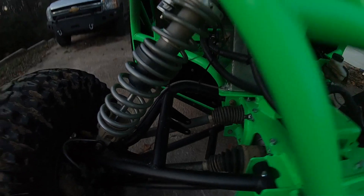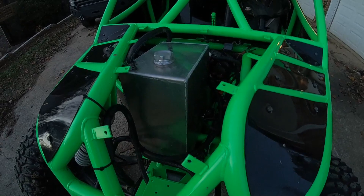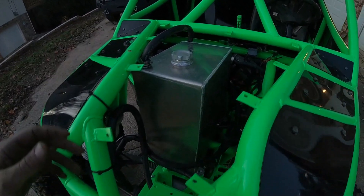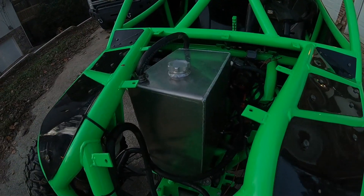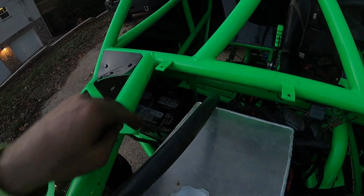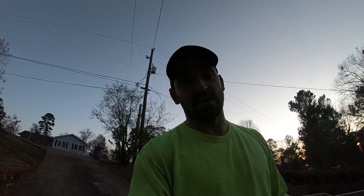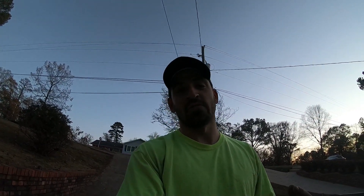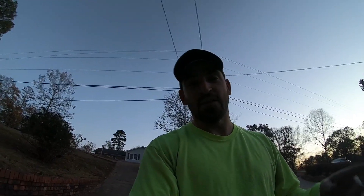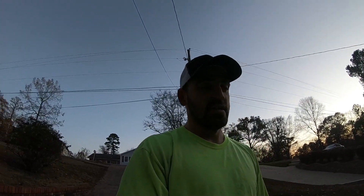Running Kryptonite tie rods. The fuel cell is probably around eight to ten gallons. I didn't have a rollover valve, so what we did is we got a piece of half inch hose and kind of looped it around up and down and side to side, that way to keep it from spilling out. We had to replace the battery Saturday morning — the battery was shot after sitting because I didn't put it on a trickle charger. And this one diff — got rid of that old diff. If you've seen the last video where we rode with our friend Red and David Uptain and Razor Life, I actually exploded my stock turbo diff. That's why you see me just beeping on it, because I didn't really care about it — I had this sitting in the garage and I knew that was the last ride on it, so I was just gonna let it eat.